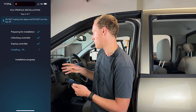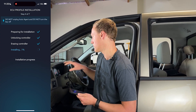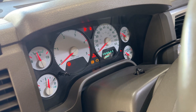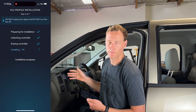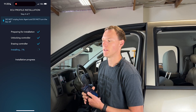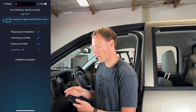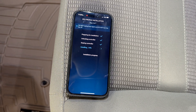At this point, you are going to hear the truck make some odd noises. You're going to hear your fuel pump cycle on and off, hear the gauge cluster ding, and probably see a lot of lights light up. If your truck has weak batteries, you do want to plug it into a battery tender because it is loading five tunes on the ECM. You can also — if you have an aftermarket lift pump — unplug that lift pump so it's not drawing power by cycling on and off. In this case, the truck has a factory lift pump so you can't unplug anything. Watch the screen — it is going to give you a progress bar for the installation.